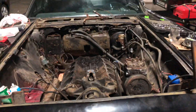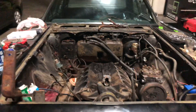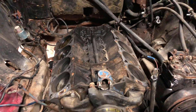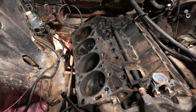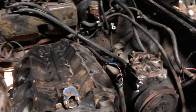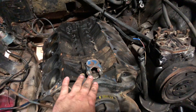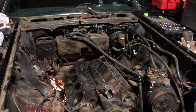I told myself when I got this '61 last year that we at least have to hit up the drive-in movie theater out here in Oregon by the end of the summer. Once I pull this block, it really shouldn't take me too long to clean everything up — clean all the gasket material off, probably put a new oil pump underneath, probably put a new fuel pump pushrod in, even though I'm thinking I might plate that off but have the option later on to go with an electronic fuel pump. Lots of good stuff.